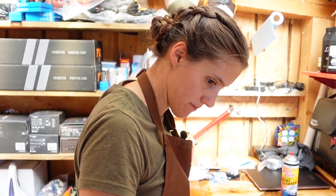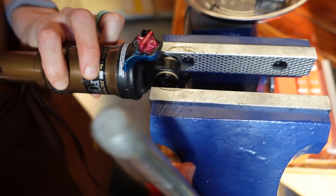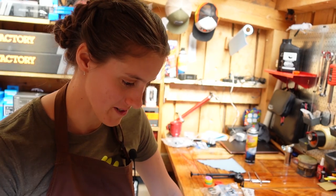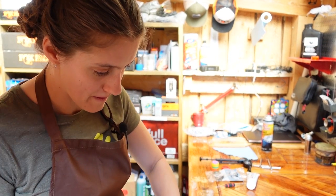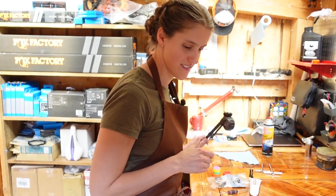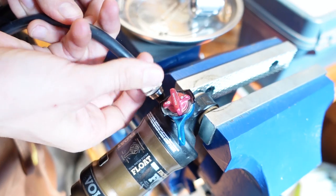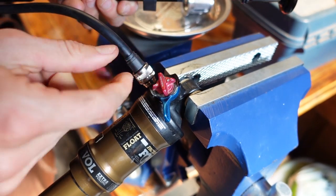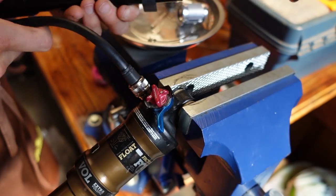The first thing you're going to do is clamp it into the vise. You've got cat hair everywhere. This part is used to being clamped — that's its job. This looks like a single piece; I don't feel super confident about taking it apart. Do you want to guess what the first step is? Take the air out. Yeah, but first record the air pressure. I always forget that step. Pretty much anything you do on your suspension, the first step is recording your settings.